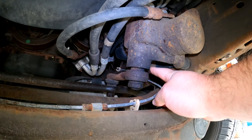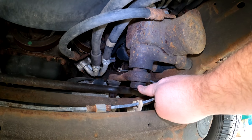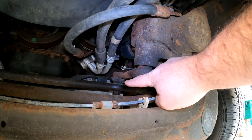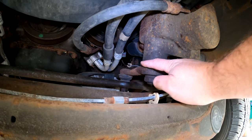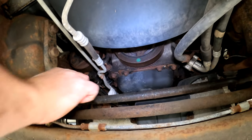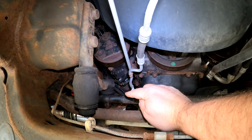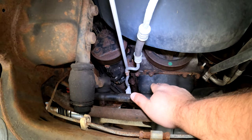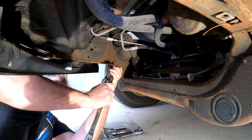There's not a lot of clearance here between the frame rail and the pitman arm. I did test our MAC tools kit here and I can get it in. As long as this isn't frozen to the steering box we should be able to pull this nut, which I think is a 33mm. We'll pull that off, pull the tie rod out of the center link, then put our MAC tools piece on and hopefully it comes off. On this side you're going to pull these two 21mm bolts, pull the cotter pin and the castellated nut out of the center link, and use our OTC front end service kit to pull the tie rod end out. Then the center link should drop down and give us more play to work with. Loosen these two bolts that hold the idler arm to the frame — they're 21mm six-point bolts.